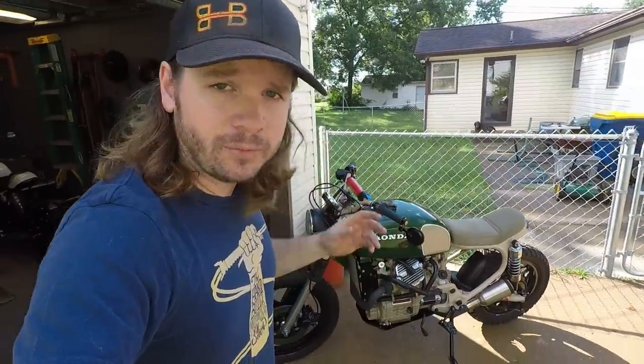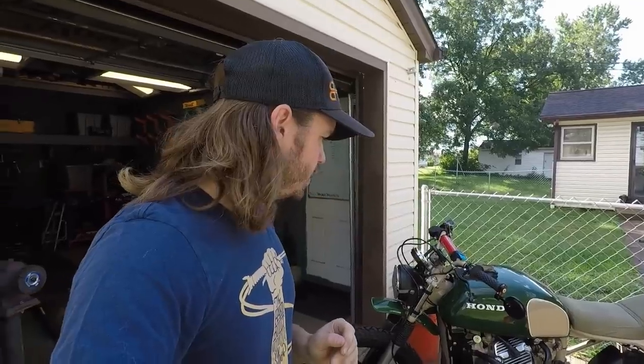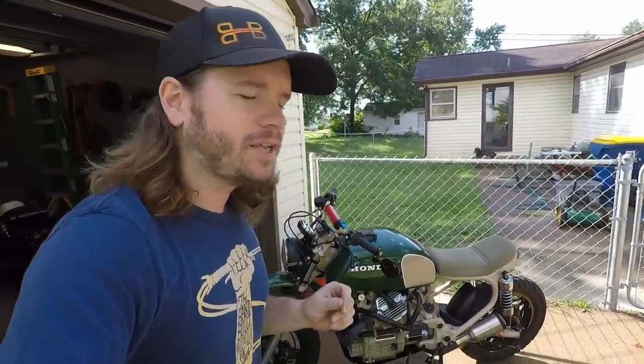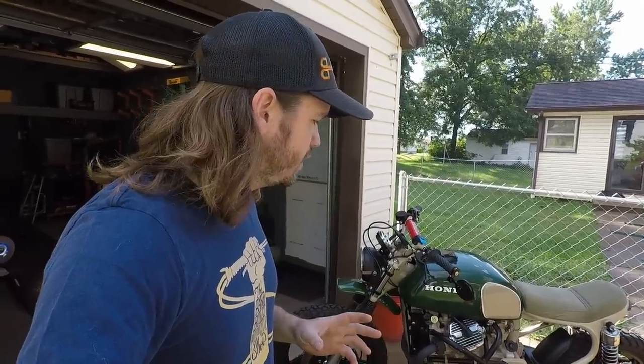Now again, to reiterate, we did a bench sync of the carburetors, and then of course I rebuilt them and cleaned them properly this time. I also upgraded from a 112 to like a 118 main jet, and we're not gonna know if that's even close until we get there. As of now though, it is still the factory 78 pilot jet, and then everything else is basically set